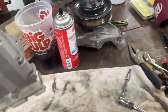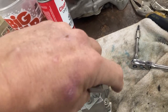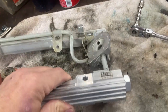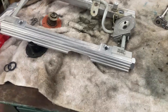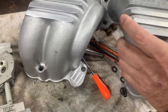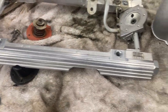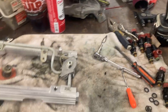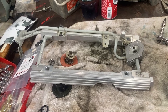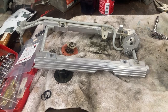Here's something else I wanted to show — I bought this on eBay. It's a block-off for the ninth injector port, which is your cold start injector. It has a tube that comes out and goes into the fuel runners. You can block that port off, and you also need to block off the corresponding port on the runner. The ninth injector wire just gets tie-wrapped out of the way. You don't have to reprogram the car — it may be a little harder to start cold, but it won't throw a code.